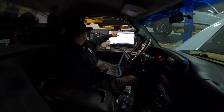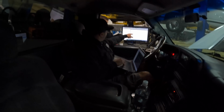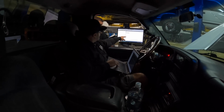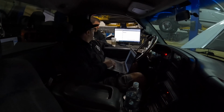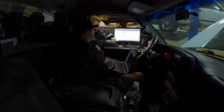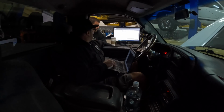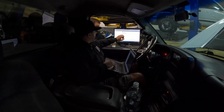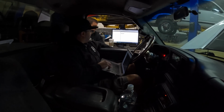But I don't see it jumping up and down on my graph like that. You can see how the power, this turbo should just continue straight up. We're not going to get anywhere near 700 today because of what's happening. And it happened from the very first pull that we did, and that's why I let out on the first pull. And you could see the power coming on and coming off and coming back on. Yeah, I could feel it.